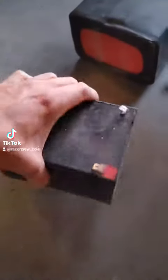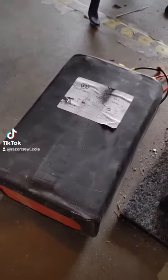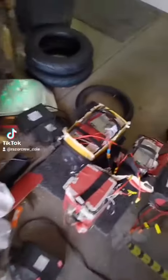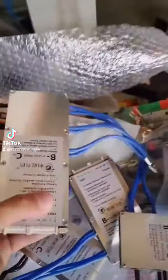If you want longer rides, you're going to need a higher AH battery. Lithium or LiPo batteries are good. Do your homework when getting a battery — these batteries ended up requiring replacing the BMS, which is a lot of work and kind of nerve-wracking.